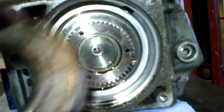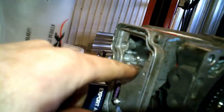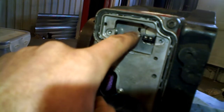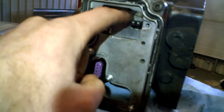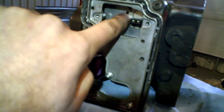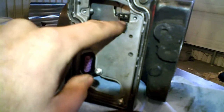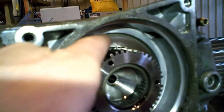What is happening is there is the clutch control unit here, and in the clutch control unit here is normally a board, the control unit board, and it's plugging in with this solenoid here. What this solenoid does is that it's a proportional valve solenoid, and with the current applied to it, it's adjusting the oil pressure that goes in, and that pushes on a working piston here around.